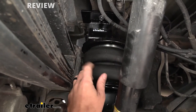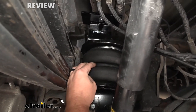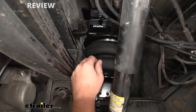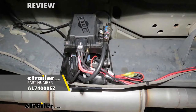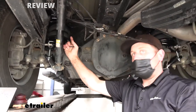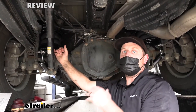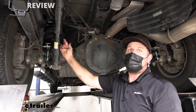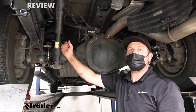Especially if you live somewhere where the weather changes a lot — hot in the day, cold at night — that's just something you're going to have to deal with. Something that makes it easier and allows you to make adjustments on the fly is a compressor system, which lets you make pressure changes from inside the cab of your truck. A lot of them are wireless and really cool — you can set presets to automatically maintain your bags. The one we've had a lot of luck with, and actually get a lot of customers to switch over to, is the Air Lift easy mount type compressor. Really reliable, wireless, and they just seem to do a great job.